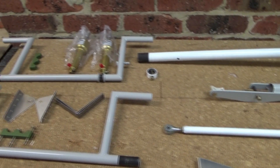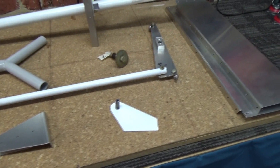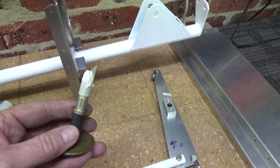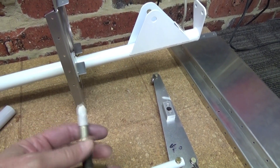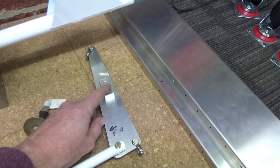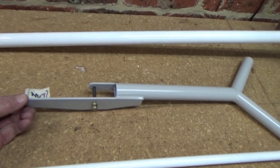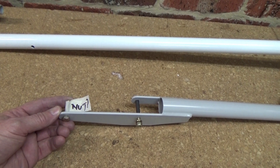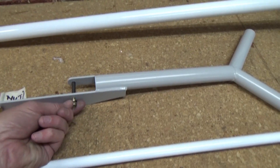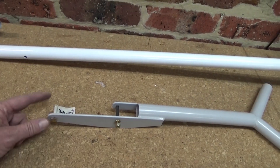With my flight control parts laid out — I'm a bit pedantic, I just like everything sorted out — I'm missing a big dash-7 castellated nut. This bolt goes through into the elevator bell crank. I'm also missing a castellated nut for the bottom of the yoke. The actual pivot bolt takes a nylock nut which is fine, so I need to source those.